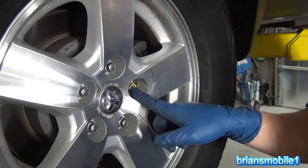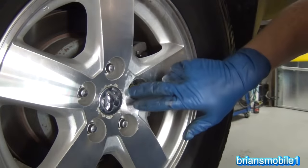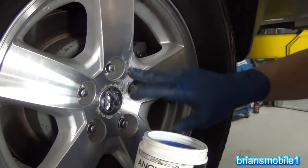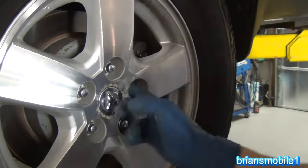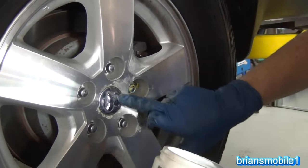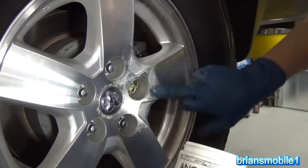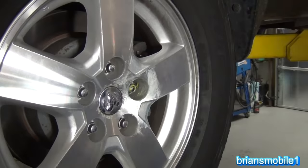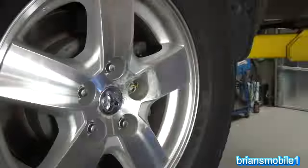So this is the damaged lug nut. I'm gonna use nozzle dip from the welder. I'm gonna smear it around the surface of the wheel. This really helps things to not weld on or burn onto the tip. So we're gonna try it here, see how it does. I don't know if it's because of the electrical properties or the fire resistance, but it seems to stay in place when things get hot. After all, anytime you try something new, it's crazy until it works.